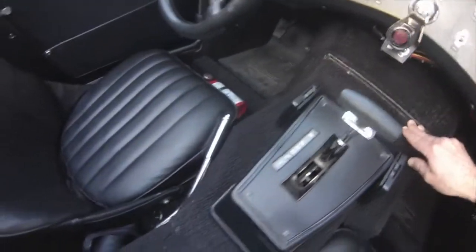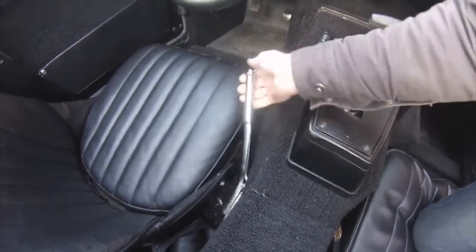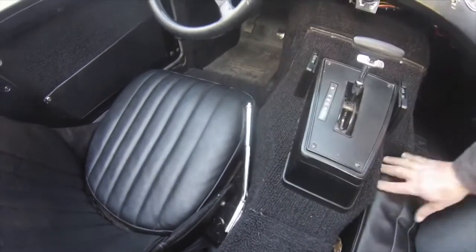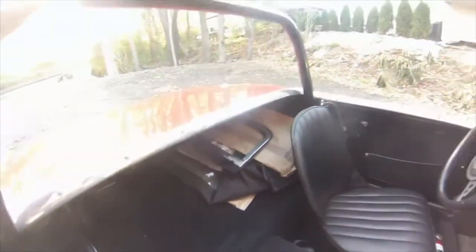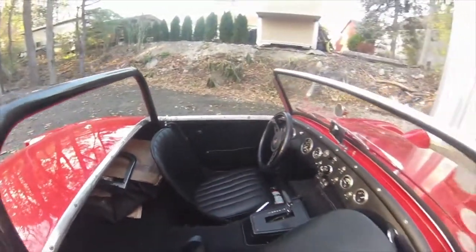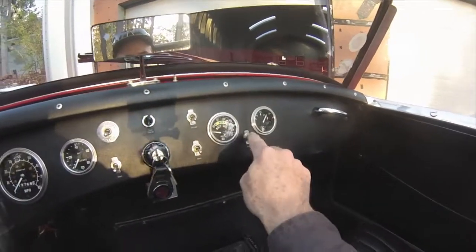The tunnel was well done — you can see how nicely he fit this in here. The e-brake had to be bent to get it to fit around the tunnel, but other than that it doesn't really encroach on your space. You did have to lose the battery tray, so the battery is mounted in the trunk. You see it there on the left behind the passenger seat. But it's really, really well executed — he's got a bunch of switches here.